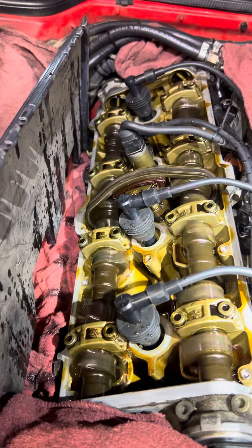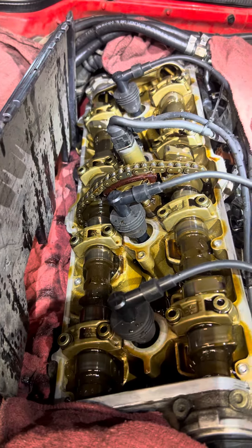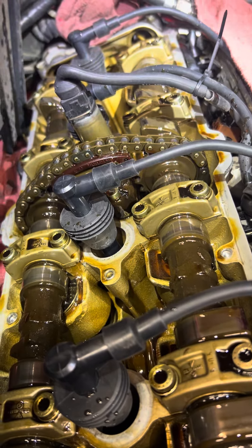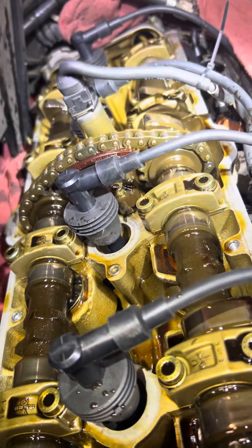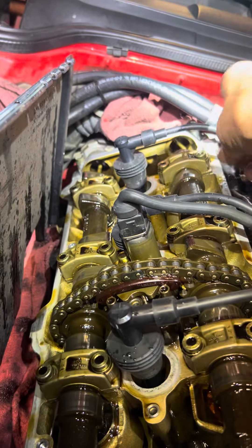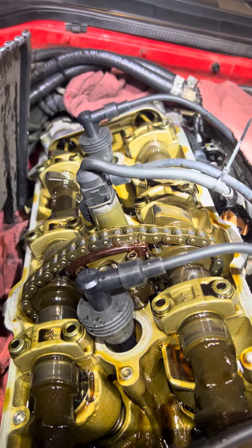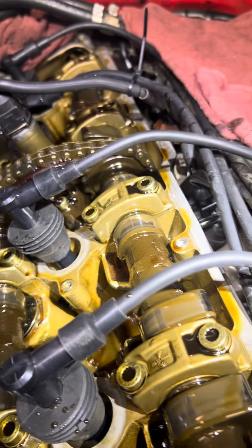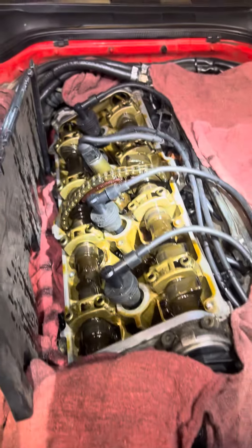Can we shut it off? All right. Now I really wanted to pay attention to some of this gurgling we saw on the other car — the lifters underneath the cam lobes, as well as this passageway in the back, not associated with the camshafts, was spitting out air bubbles after we shut the thing down.